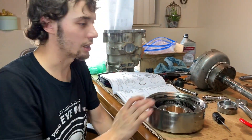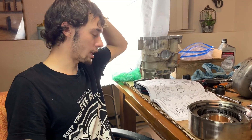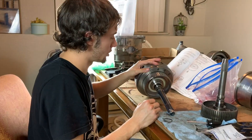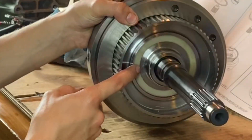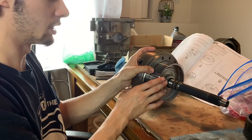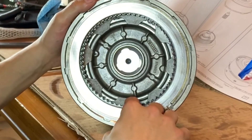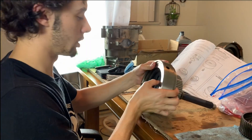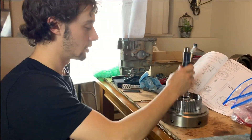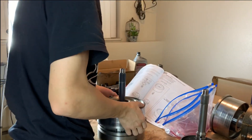Now I can move on to getting the billet input shaft installed and building up the forward clutch housing assembly. I got the forward clutch housing all assembled — new thrust washer, plastic thrust washer, sealing rings, and the billet input shaft is ready to go with new clutches, steels, and thrust washers. Since that's ready, I can go ahead and put my direct drum on because it is ready and that whole assembly is fully seated and ready to be installed.